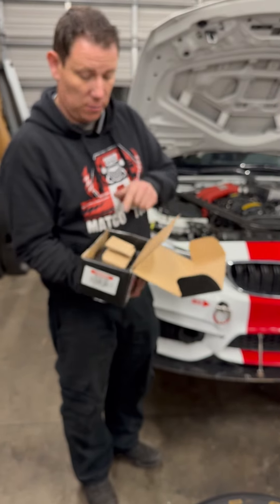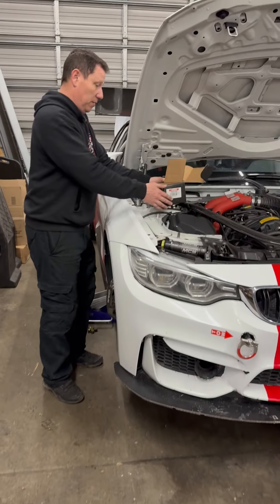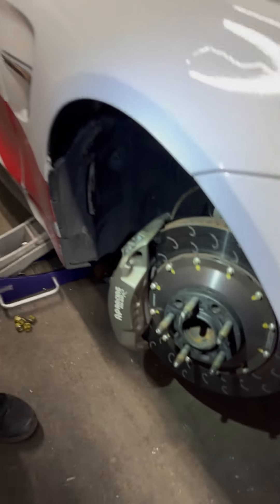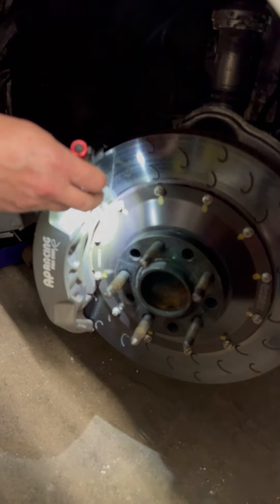So what we're doing is we're going to replace the brake pads on it, and I'm going to do a brake fluid flush on it as well, and then hopefully we'll put it back in the trailer and you should be good to go for VIR. As you can see the brake pad thickness and how it's starting to crumble apart is because it gets a little bit hot.